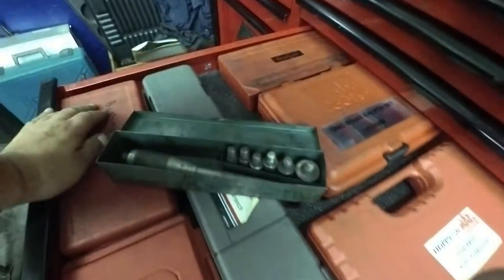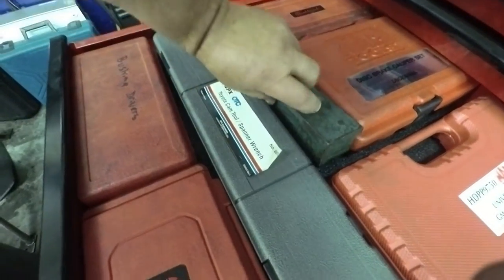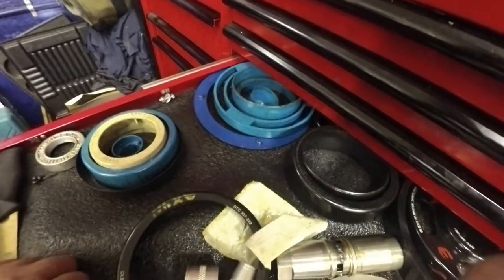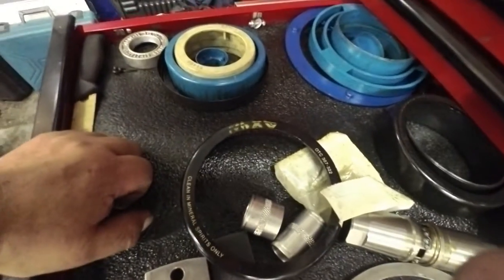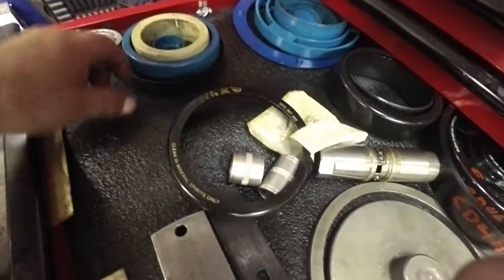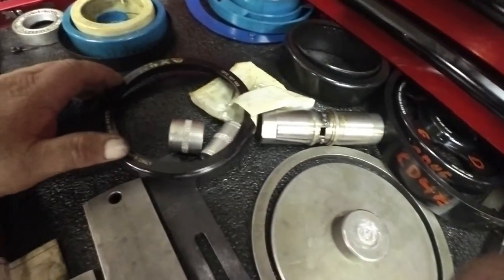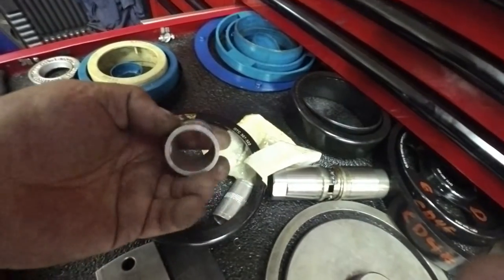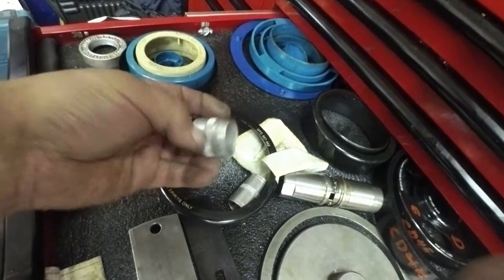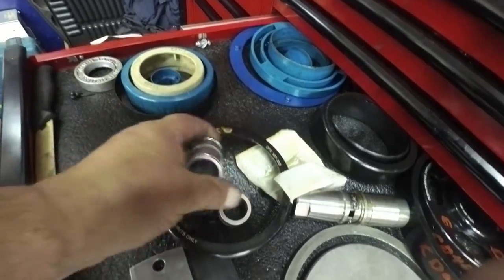This was my grandfather's clutch alignment tool — and it's old, old, old. Seal installers — this all probably came from A-Tech. This fits all different kinds: 670s does the sprag race, AODs the blue ones, CD4Es the black ones, AX4Ns, and some special seal sizers — I got them written on here — there's like 4HP22s. No part numbers on them.